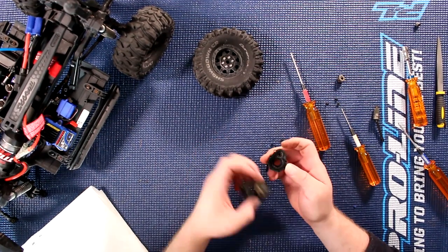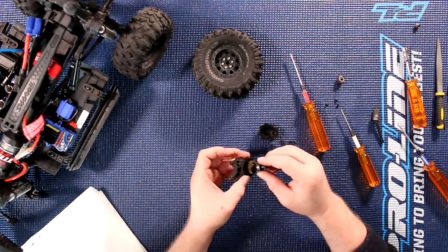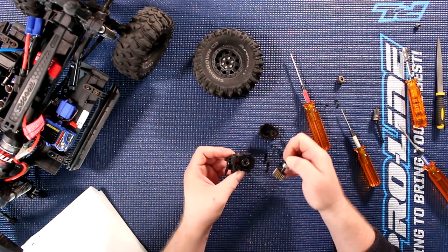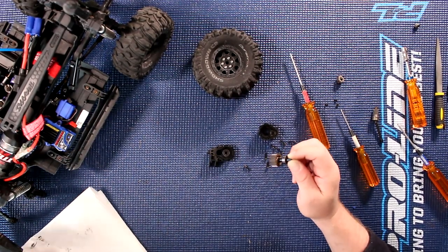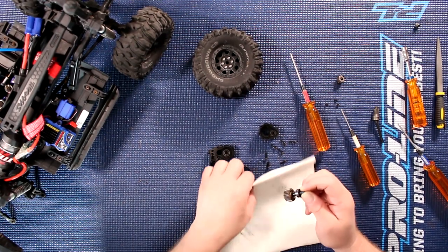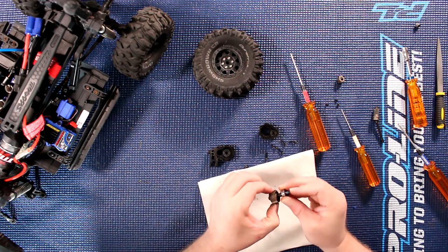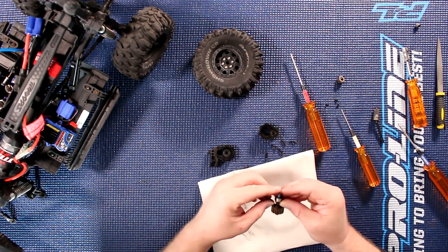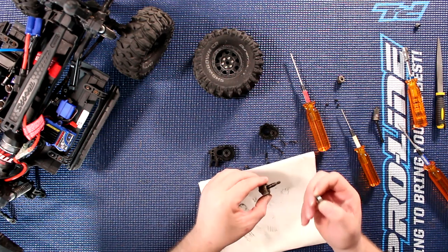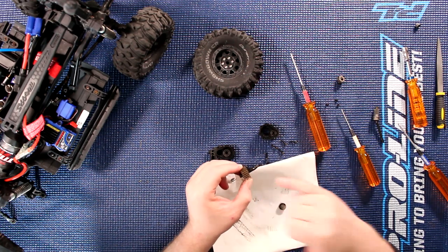Now when you're going to open the case, you'll have one bearing on the top case here. Then you have the one on the spline. You can pop this guy out and there's another bearing inside here. Now for a vehicle that's been running for two years in snow, water and rain — whatever — the bearings are really not bad inside. Now you'll notice too, sometimes these guys won't come off because you'll have a small burr on the physical shaft.